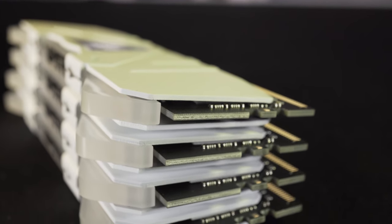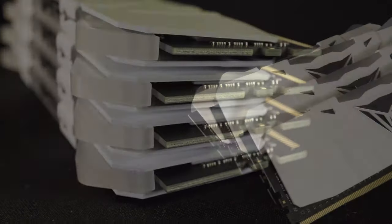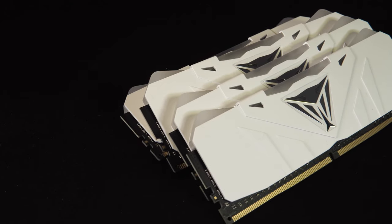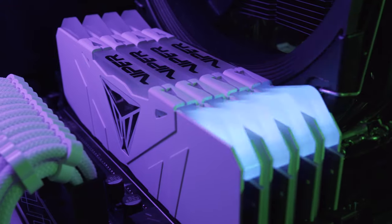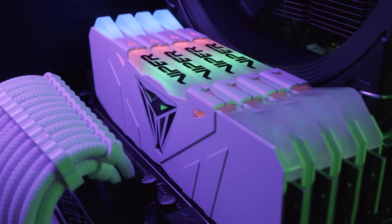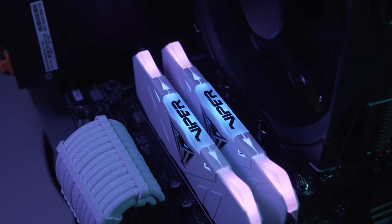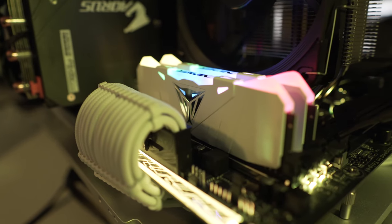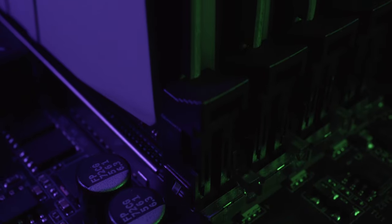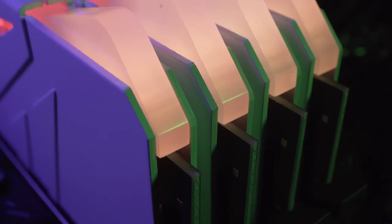As you may notice, we actually have four modules here, which comprises two dual channel kits — effectively making a quad channel kit. They are only sold in 16GB capacities, as 2x8GB modules. They sell them in speeds of 2666MHz all the way up to a whopping 4133MHz, and as you can see today, we have two 3200MHz kits. Timings are pretty tight at 16-18-18-36, and they operate at a pretty standard 1.35 volts. And of course, like most memory these days, you get a limited lifetime warranty.